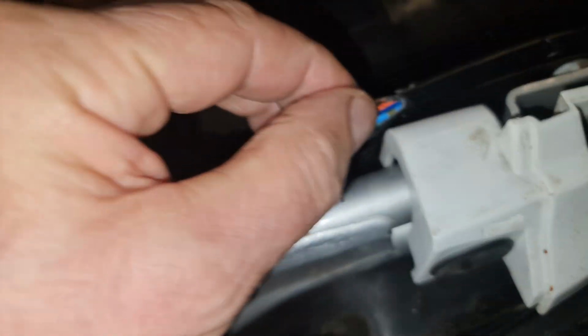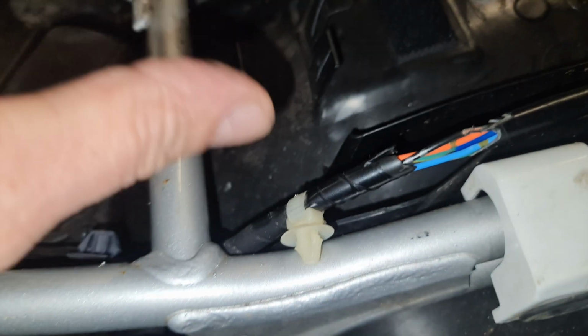So what I've done, I've got the rear wire and found the one that goes to the back, and I've just very cautiously just took the sheathing off. I went online. You might have to do this. Go online, look for your wiring diagram for your particular bike, and it pointed out that it was black and green and yellow. That doesn't mean it's going to be all the same for other bikes. This is on my bike.